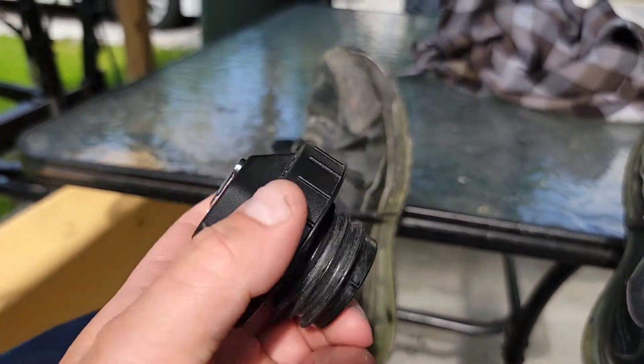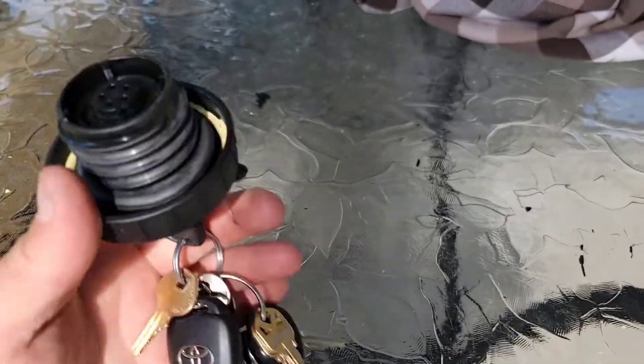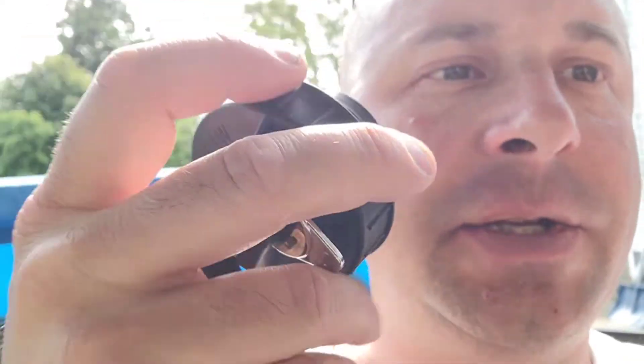These locking gas caps actually have a valve in them — when you insert the key, they're vented. If I blow into it and push the key, you can hear a little valve click, and every time I release it stops — so I know that part of the cap is good, as silly as it sounds. There's only so much you can inspect on the cap visually. Also, if you top off your gas and click it multiple times after the pump stops, that can damage your charcoal canister. If you don't do that, the canister should basically last the life of the vehicle.